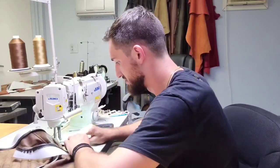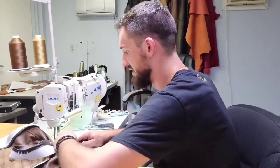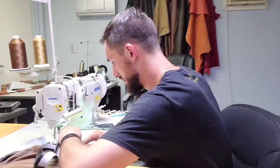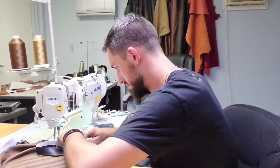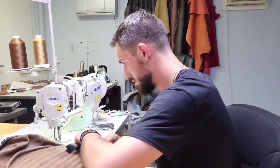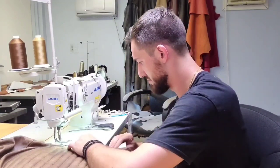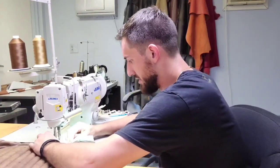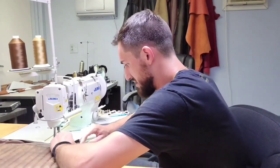See, even right there, I almost messed up. It started sliding. The leather wasn't moving, but the vinyl was moving, so it almost went down there. It's a good thing that this vinyl is stretching. And I'm still coming up just a little bit short, so I'm going to pull just a little bit, and it won't mess it up because, again, this gets pulled all the way underneath the pan and then stapled. So it's coming up like an eighth of an inch short, but that's okay.